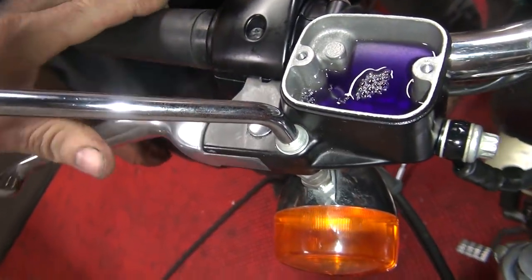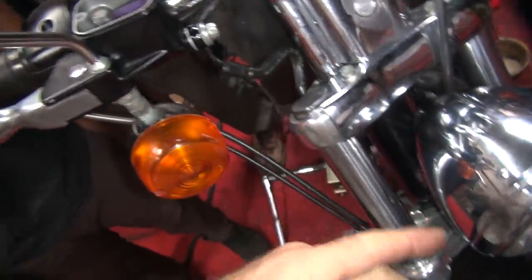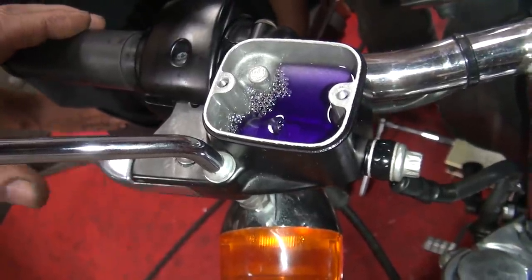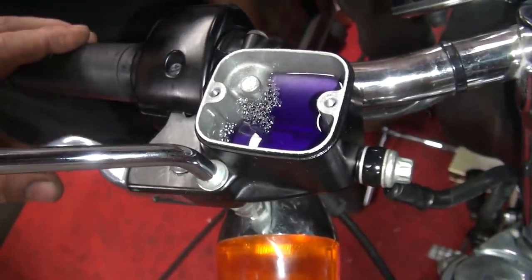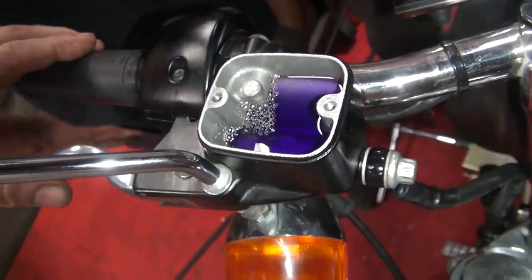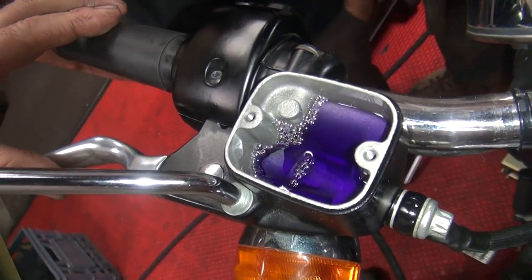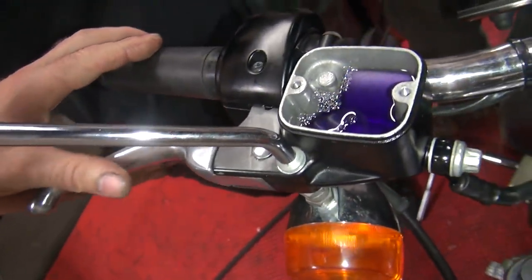We get one squeeze, pull back and let it sit for a few seconds. You know why we're doing that? Because we just put a bunch of fluid down the line and never let the air come back up. The fluid is going to work. Did you see all the air bubbles come up when I did that? Now what is the reason we're trying to bleed brakes? So she can stop? So we can get the air out of it. So we can stop. We're getting the air out of the system. Oh, air coming up.